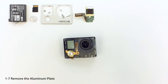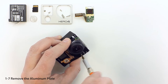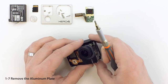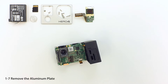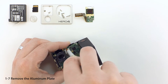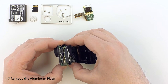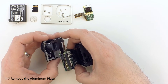Remove the two screws located below the lens — be sure to save them as they will be needed later. Remove the screw holding the main board onto the aluminum plate and save it for use later in the project. Gently lift up on the board to separate it from the aluminum plate and angle it down and away to remove it. Don't force the board — this step may require a little patience to get the angle just right.